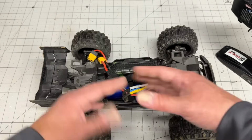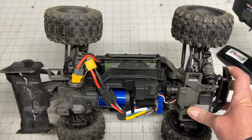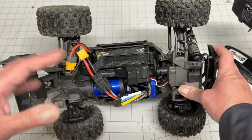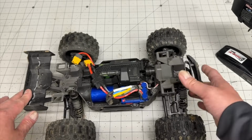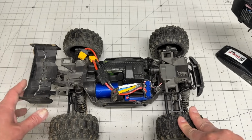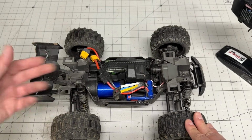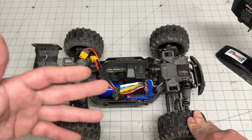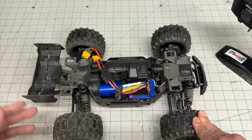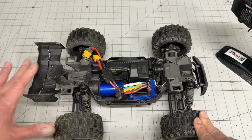Having a little bit more freedom and more adjustment, or basically more ability to have different speeds front and back, allows it to land on the ground a little bit better, a little bit smoother in the power delivery. The wheelies are not quite as insane. It's just, especially on 3S, kind of a handful when you've got that lock differential feeling. You don't need super thick oils on these mini scales. I know 10 scale, 8 scale, you might run 100K or even higher, but on mini scale stuff, you can definitely get a lower diff fluid action. I think you'll find it drives a little bit better.